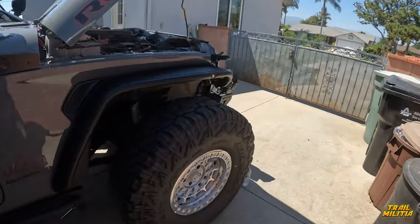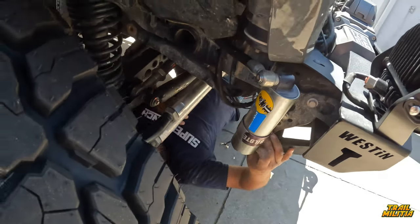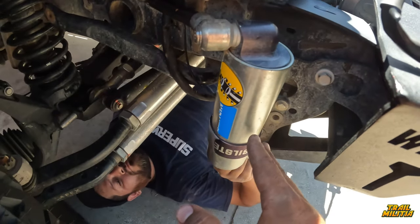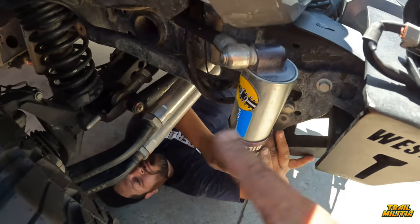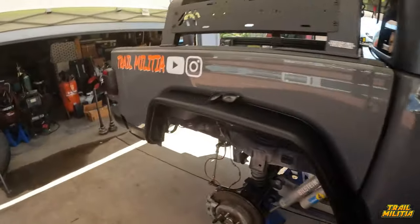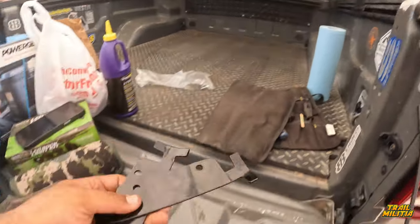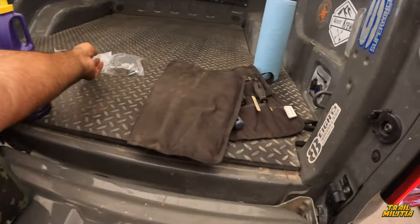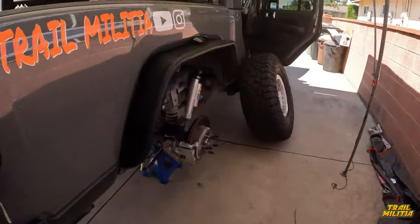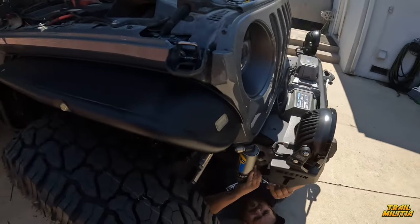Moving on to the reservoirs — Danny's working on it now. We've been rubbing on the tire probably since I've had the truck. The bracket wasn't the right one — it's actually upside down — but it was what they had when the shocks first came out for the Gladiator. At full articulation it does touch the tire. Instead of that bracket, I'm using Radflow brackets — the same ones I used on the Bronco — with regular clamps to relocate it inward and give more clearance.